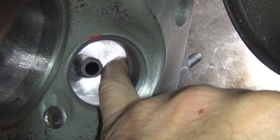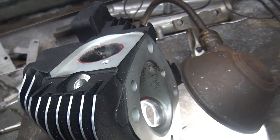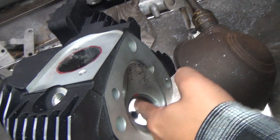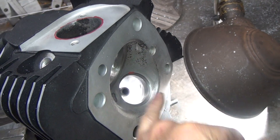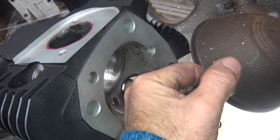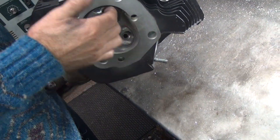It goes in straight, then it makes the radius. But when you get up over here, it becomes really crabby right there — you can see it's all cut away right there. Feel that top edge when you come across it. See how bad that feels right there? It feels horrible. All this other stuff has a nice long radius, but in that crappy area right there — that's where our airflow is going to be killed because there's no radius. It's good here, and then boom, nothing, then it's radiused again. Compared to what it used to be, we actually got some flow through there right now.